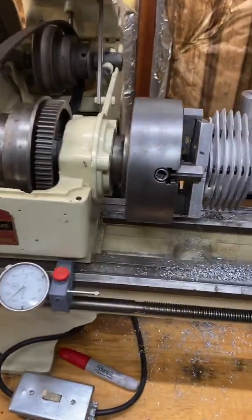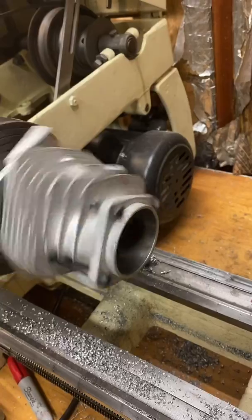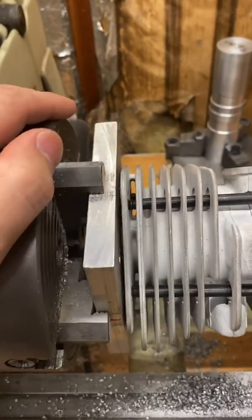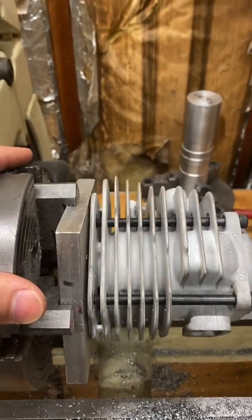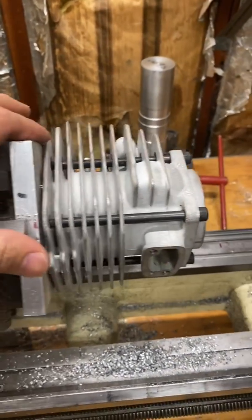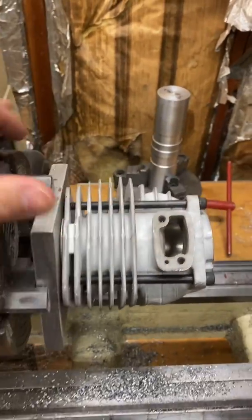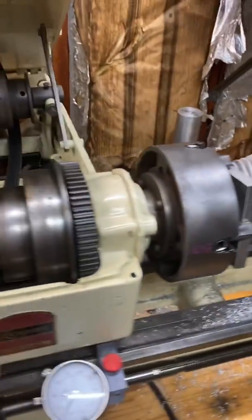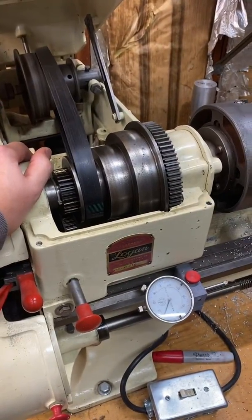So we're here at the lathe. I got it all zeroed in. The way you do that is basically three different ways — you chuck it up here. The easier ones to get zeroed out quickly are ones that happen to be flat on top of the cylinder. Others like the 461 or 460 where they kind of come to a point — that makes it harder to get bolted up to the fixture nice and square. One of the biggest hurdles to getting started with porting — as far as base cuts and squish bands — is getting your mind around how to do this.